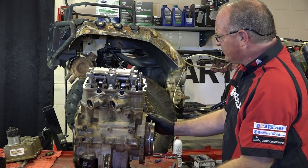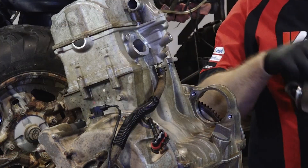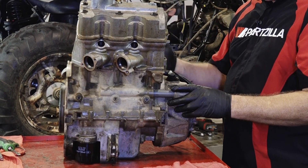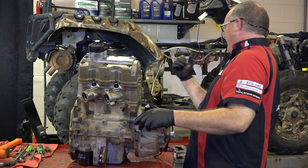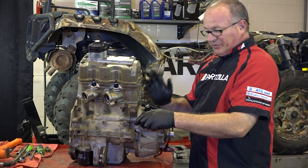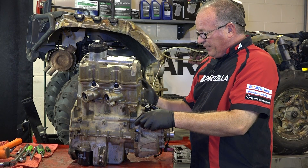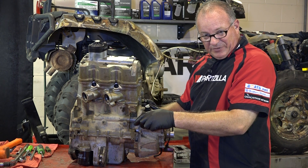That'll pretty much complete it. We went ahead and got the stator cover back on, got the starter remounted so I didn't have to do it while it was in the frame. Valve covers on, everything's tightened up, we're sure about the timing, we've got our new piston rings in there, the valves look good, and this pretty much completes the reassembly of the engine. We still need to get this back in the frame — that'll be our last video installment for this project. If there's something you couldn't see or you have a question, leave it in the comments below and I'll do my best to answer it. And if you need any of the parts or gaskets we used, come see us at partzilla.com. Until the next episode, thanks for watching.